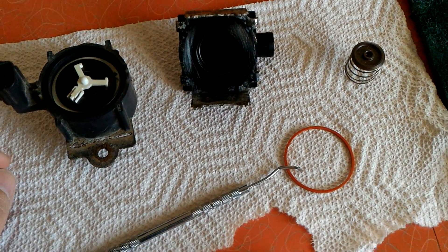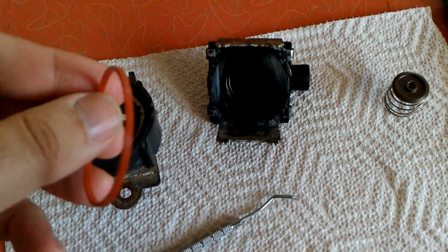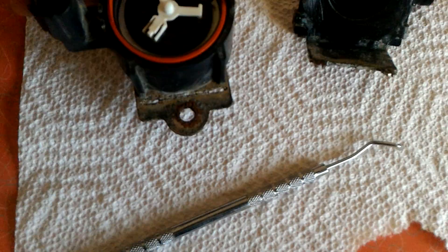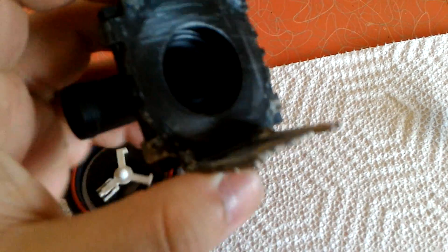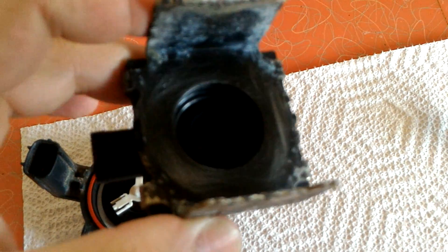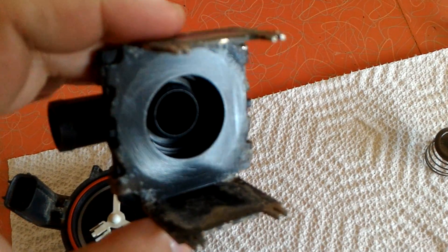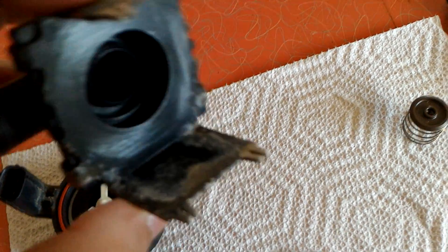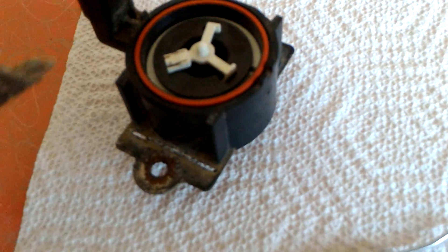The main issue where you'd be leaking air from is going to be two points of failure. You have this orange rubber O-ring — yours could be white in some cases on Hondas — and this guy sits directly in here. Where it makes a seal against is this cover that actually has the hose barb on it. This metal under here, as you can see, looks like it's a little bit cleaned up, almost polished. That was all corroded because water and moisture had eventually gotten into it. This piece is just plain steel, so eventually it's going to have issues. When this cover goes on top, it's going to seal against that rubber O-ring.